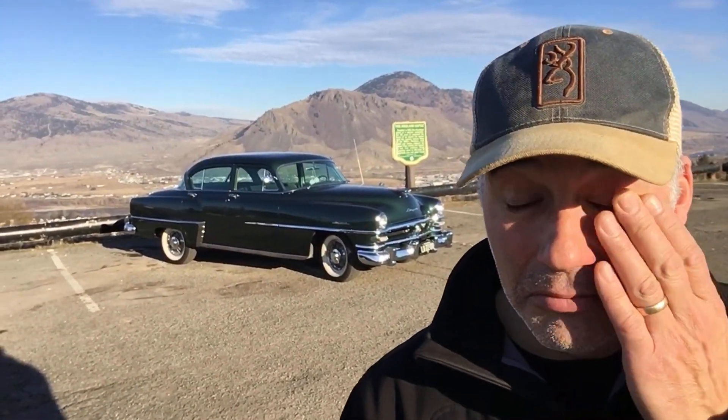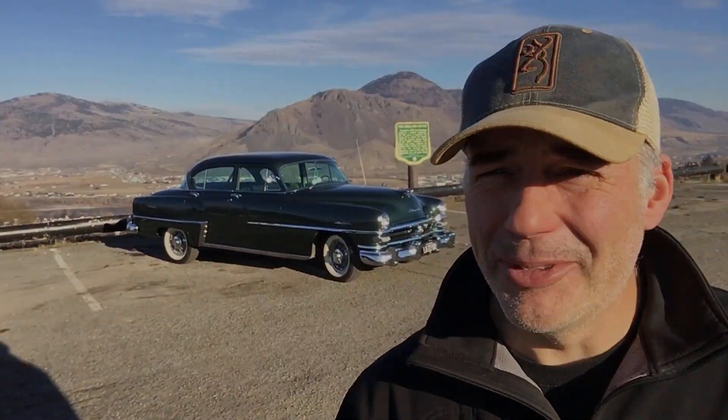This next video we're going to talk about really tearing it further down into the block. I'm going to take out some valve guides, disassemble the entire oil galleries, push out some valves and springs — typical stuff just to get that block torn right down. It's pretty much ready to ship out now, so I'll just review my steps here on the past week of what I've been doing for my engine, getting ready for the machine shop.